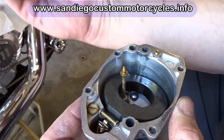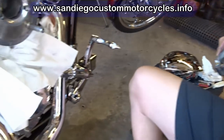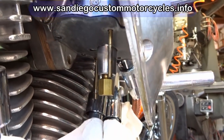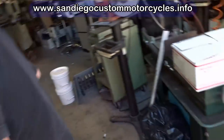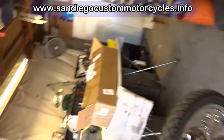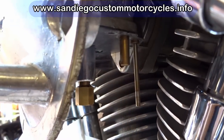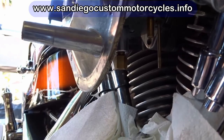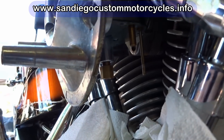The jets are in the carburetor body. The O-ring is up inside there. Our intermediate jet is right here on this side. If that thing is a 29 and a half, then we've got problems somewhere else. Confirmed: 29 and a half.